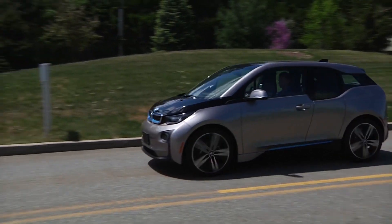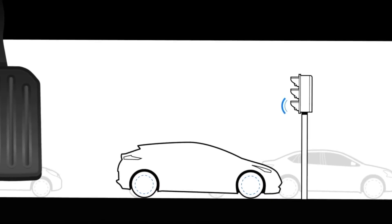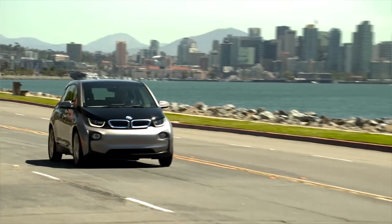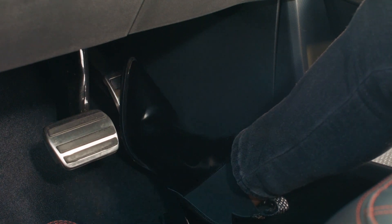To bring the car to a complete stop it will start to use the friction brakes — maybe that's the brake pads at the front on the latest VW ID cars, or even drum brakes on the rear. It's at this point of blending that the system is most impressive. When this technology was in its infancy, you could definitely feel when the regen braking changed to friction braking — the crossover point was quite noticeable in some cars. The car has to figure out how much brake pressure is needed and blend the force of the friction brakes with the decreasing level of regen. In good modern EVs, there's no change in the braking sensation for the driver — they don't even know the friction brakes have been applied.